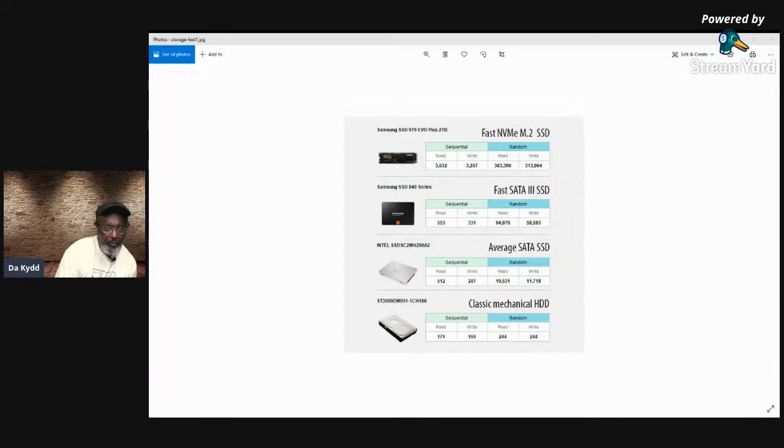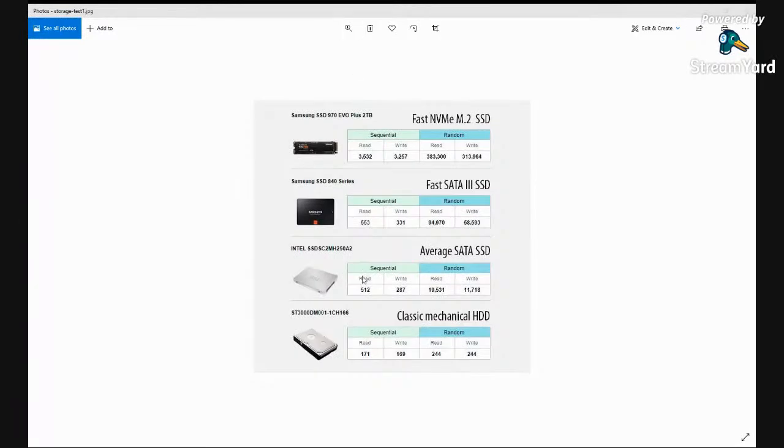Now, the read and write speeds, you open up full screen. With the standard mechanical, sequential is about 170. Yeah, about around 170. And like I say, we thought the read would take longer because it has to search for it. But the read is faster than the write. This is sequential, and then you've got your random speeds for each of what the heads do.